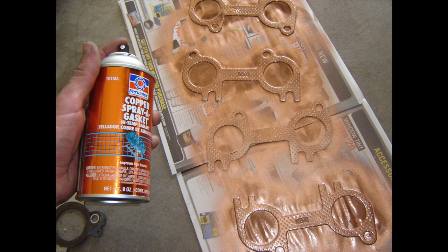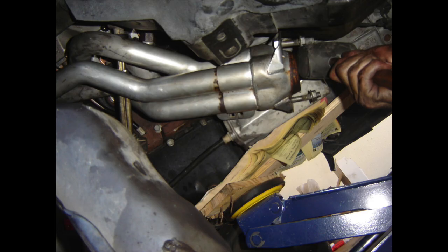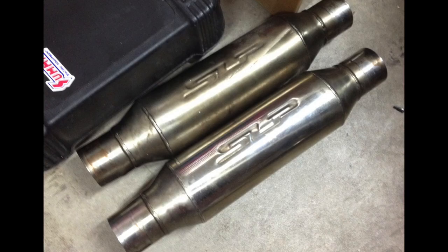It was a learning process and we would go on to do this on a lot of our friends' cars later. My neighbor suggested coating the new exhaust gaskets in copper seal and putting some on the heads — we tried it out, I don't know if I'd recommend it but we did it at the time. Then we installed the headers — they look so good coming down like that. I found some Loudmouth 1 SLP exhaust resonators that I wanted on the car again and bought another set. The one on the bottom is skinnier — that's the Loudmouth 1 — compared to the Loudmouth 2 on top, which is fatter and has sound deadening material inside with perforations. It's still a straight-through muffler like the Loudmouth 1, but it is quieter. I like the Loudmouth 2 better and got a set of those to put on.